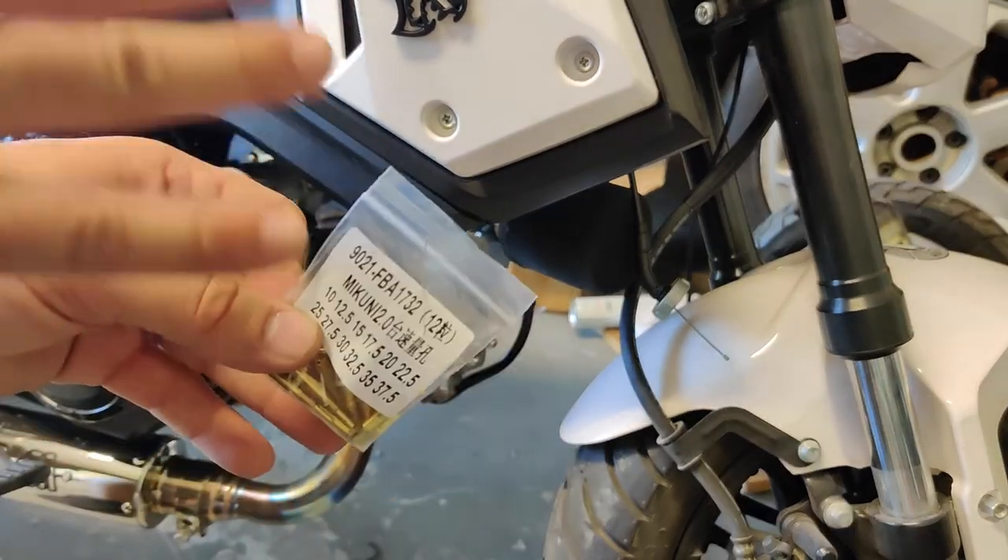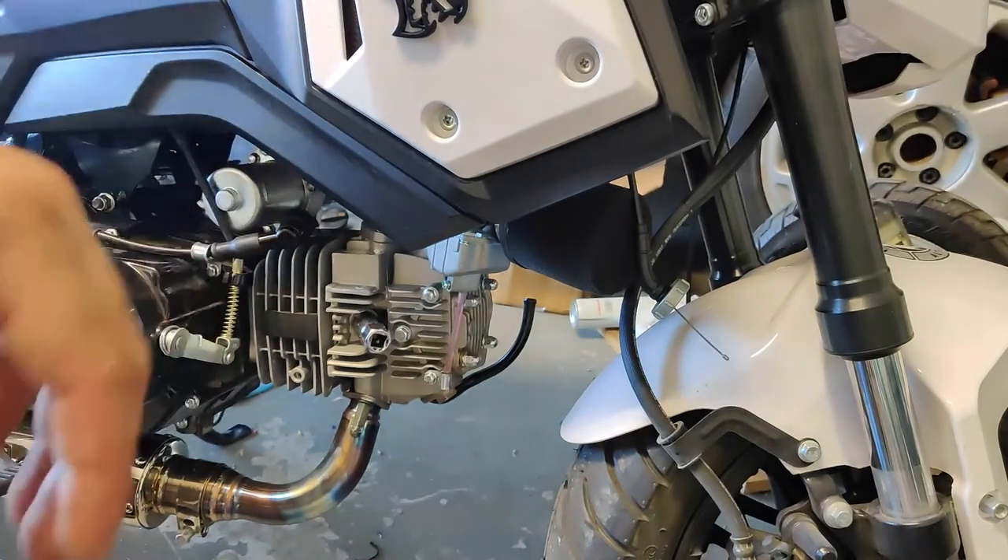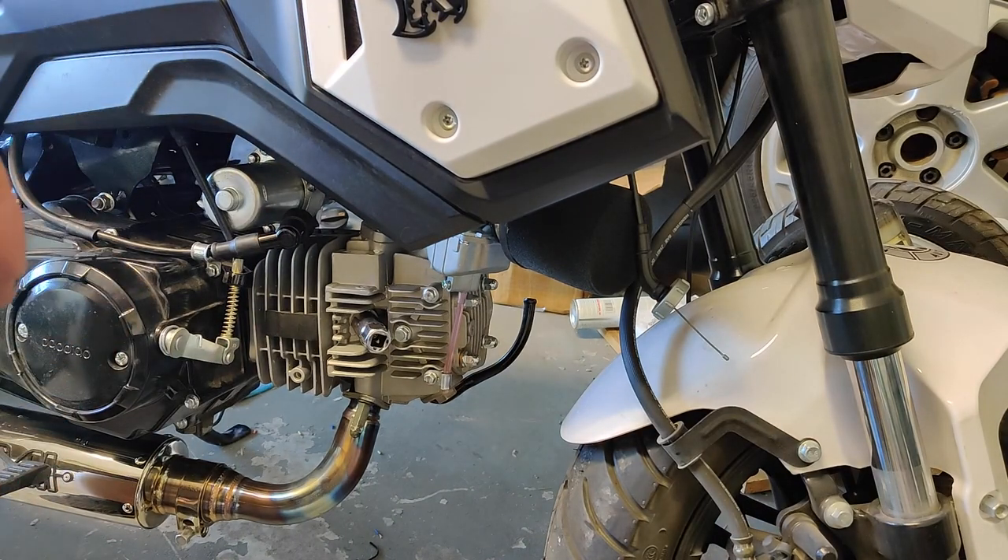I'll link the jets I bought below from Amazon — these are the main jets and these are the pilot jets. They're very specific on the different numbers, which has to do with head diameter, thread pitch, and overall length, so look in the assortment for the sizes you're looking to get. That's all for now guys — the bike is running great. I'll be meeting up with David again soon and we'll do a new ride on these bikes to see how these mods have affected it, comparing his more stock bike to mine which now has intake, exhaust, and the new carb tuning. Alright guys, that's it for now. Bye.